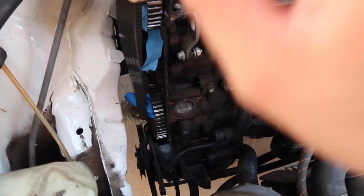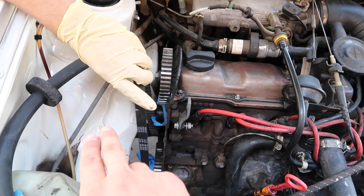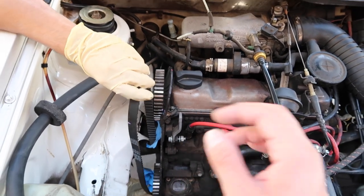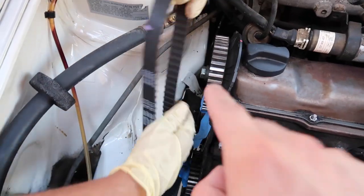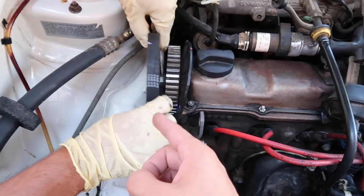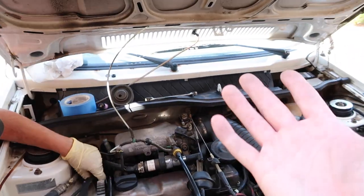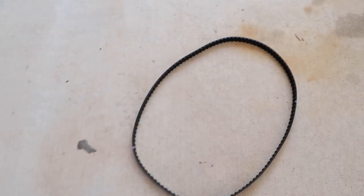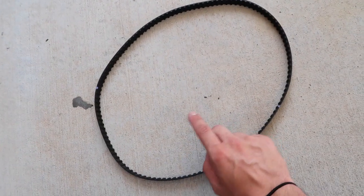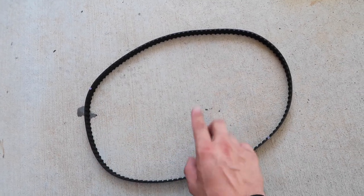What we're currently doing now is putting the new timing belt in — we are on the crankshaft and the camshaft. We had the marked areas on there; that's why you kind of see the purple nail polish, because we had lined them up with the marks. Unfortunately we cannot put the new timing belt pulley back on because down there we have the motor mount, so to take that pulley off we would need to lift the motor. With the markings, we counted 55 threads from purple to purple to line up with the timing belt.